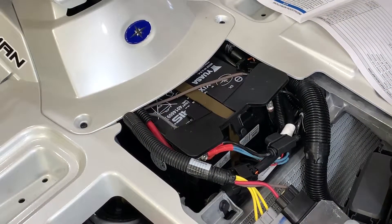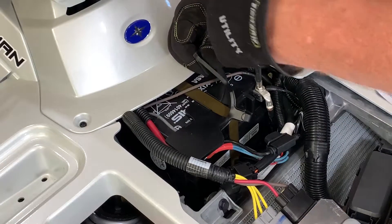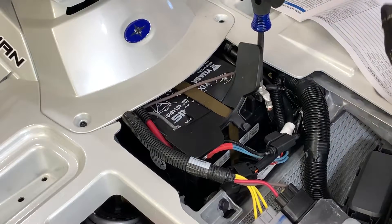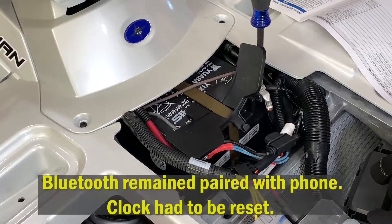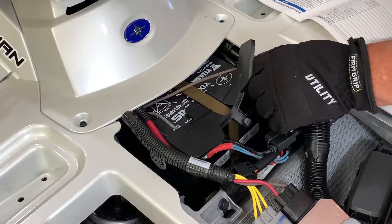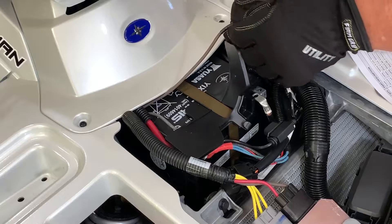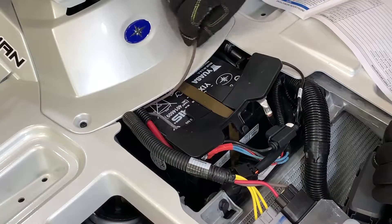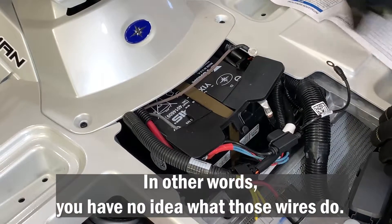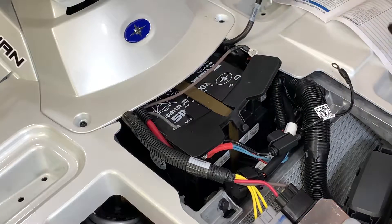The first thing we're going to be doing is taking the battery off, and always take off the black cables first. If we lift this up here, we can see the black cables — these happen to be just done with Phillips screws. I am curious to see later, once this is all disconnected, if it undoes the control unit, because I've got the Bluetooth and the dashboard unit connected. So we'll see if that undoes it — if you have to reset the time, repair your phone. First thing, disconnect this. You don't want to lose any of the connections that are here — you want to remember what's connected. Set them aside. There's a brown one here, this black one here, and of course the main cable. The screw itself I'm going to put in this little dish up front where it won't get lost. Take the power cable off completely and set it aside so that everything is out of the way for the installation.